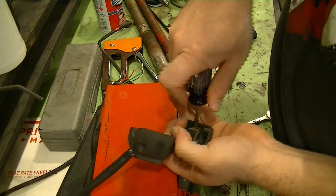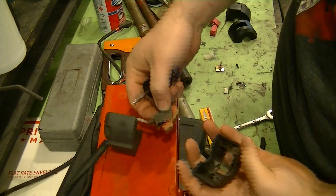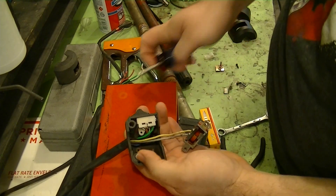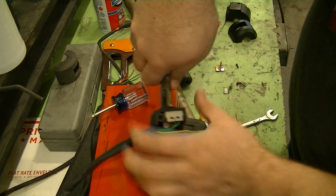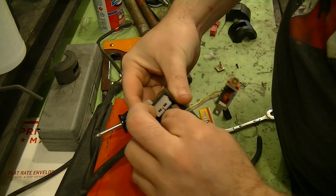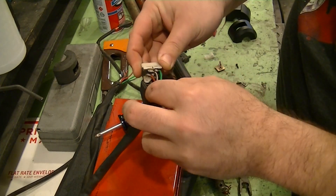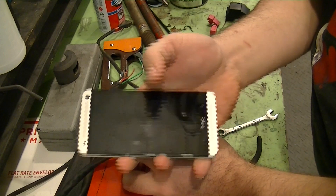I can remove the actual switch assembly — the switch housing. You've got one screw right here. In order to take this switch assembly off, you've got to pull this actual switch plastic piece straight out so that you can then wiggle this up and out. Now I need to keep track of exactly where each of these wiring hookups go — that's where I use the secret weapon: the smartphone.